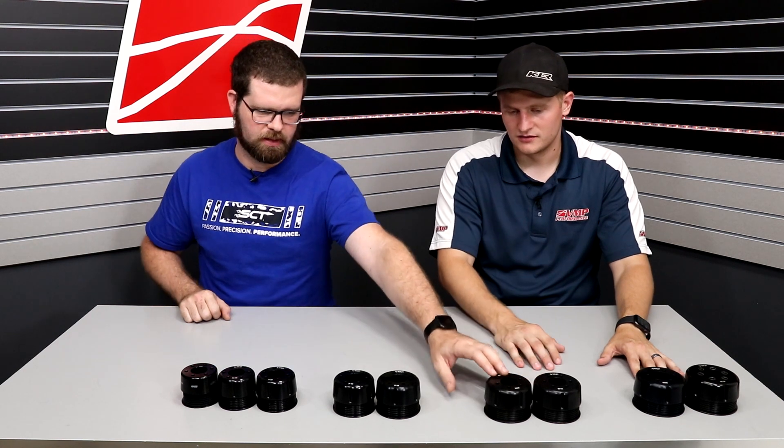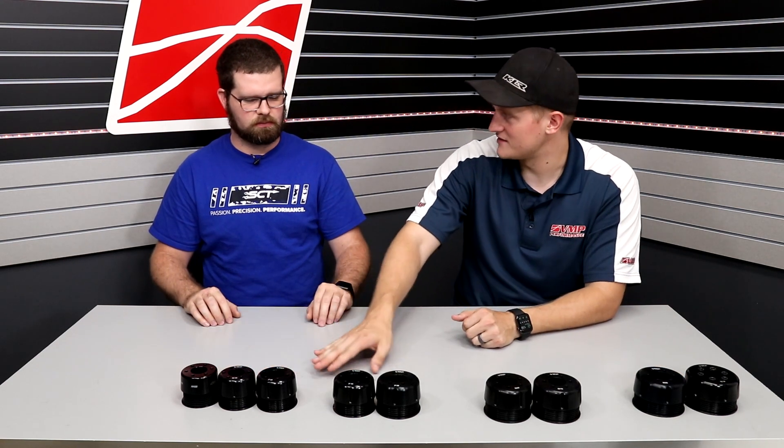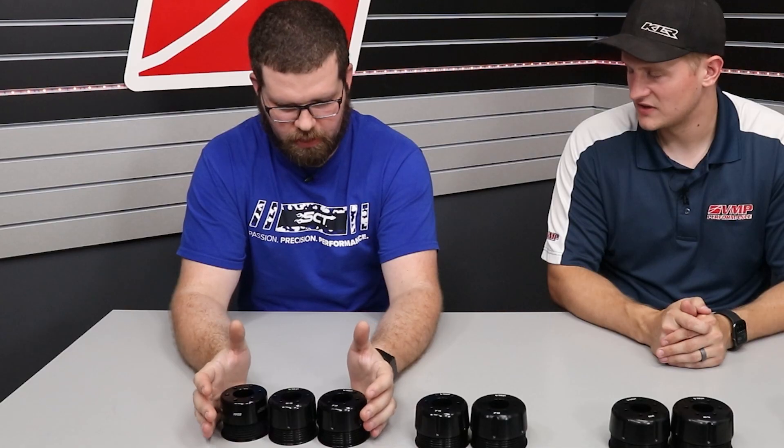The last thing I wanted to touch on is what you can expect from a realistic belt slip and belt life standpoint. Belt life and belt slip on the larger pulleys — pretty much nonexistent. That's going to last for a long time. The only time you run into belt slip problems on these is when you don't have the right size belt on it to begin with, or something's drastically wrong. But having the understanding that if you run like a 66 or 69 millimeter, the chance for a belt to break, the chance for a belt to slip, the chance for the belt to just not last very long — it's something you have to be understanding of. You're spinning the blower very fast, especially in a 6-rib setup, and it's a mechanical disadvantage at that point, because you don't have the mechanical grip of the larger diameter pulley working to your advantage. That, or an 8-rib or 10-rib setup where you're going wider on your traction surface — but you better make sure you have the right size belt and a good tensioner.